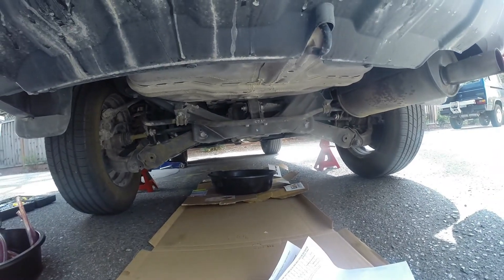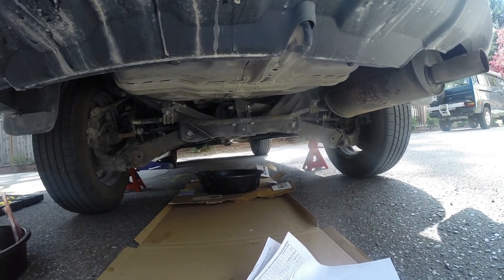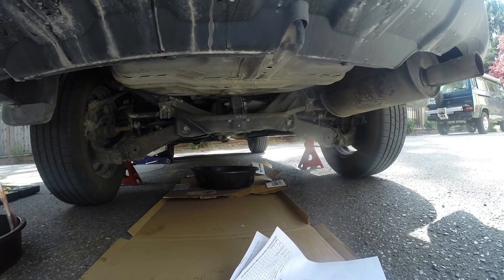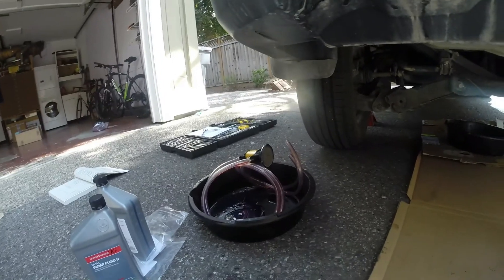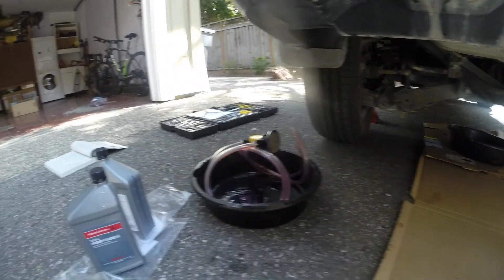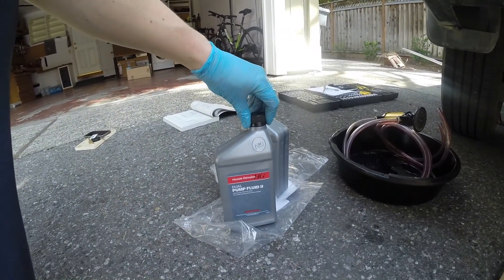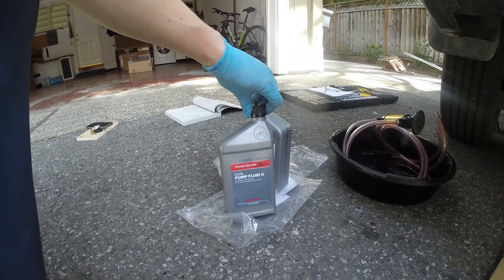This section is about refilling the rear differential with fluid. You have the cardboard on the ground with the oil pan to make lying more comfortable and to collect spillage. Take the wrench, unscrew the fill plug, and use an oil pump to pump the fluid from the containers into the fill plug until it runs out of the fill plug — that's the correct amount. Put back the fill plug, screw it shut, lower the vehicle, and you're done. Thanks for watching — check out the links in the show notes.